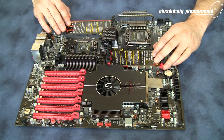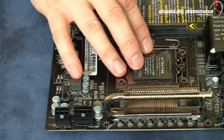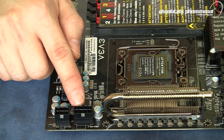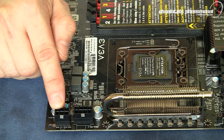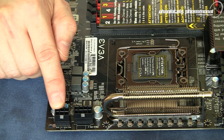The SR2 can hold up to 12 DDR3 memory modules with a maximum capacity of 48 gigabytes and rated speeds in excess of 1333 MHz. To power each socket on the SR2 board there is an 8-pin ATX 12-volt power hookup. Next to this is a 6-pin PCIe power hookup, which is not necessary unless you are doing extreme overclocking on this motherboard.